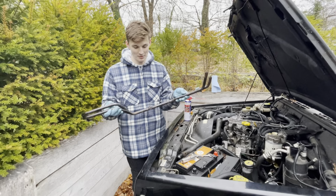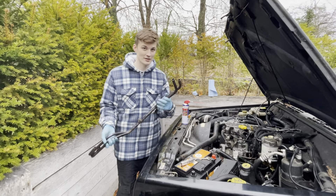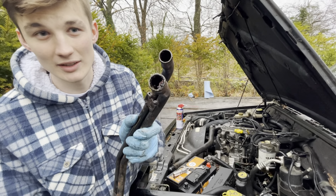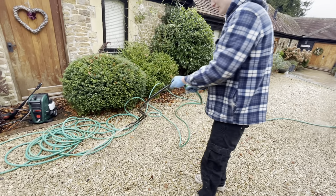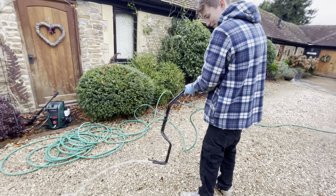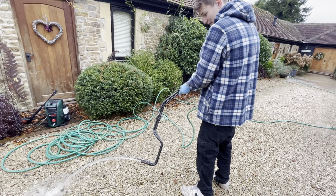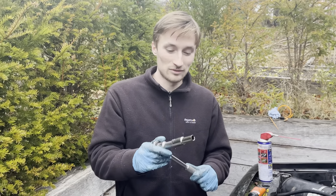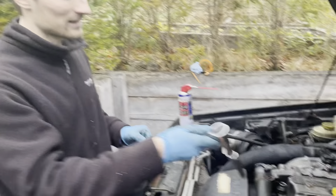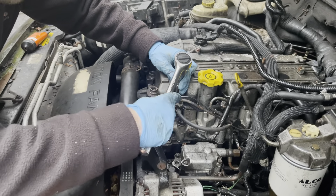It's not in the best shape, so we're going to give it a brush with a wire brush and a couple of coats of fresh paint. As you can see, it's really dirty inside, so we've sprayed the hose down to clear it out and it's running nice and clear now. We've just been to Halfords to get a 10mm socket for this wrench so we can actually access the glow plugs. I've loosened this first one off a little bit already.